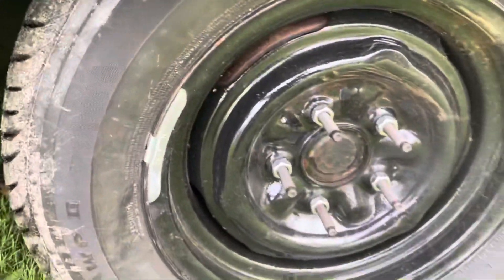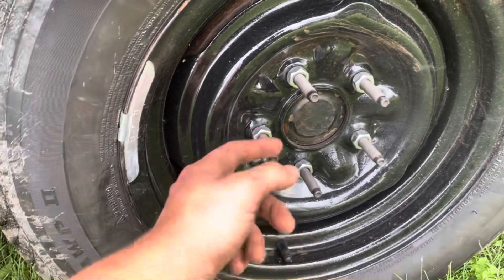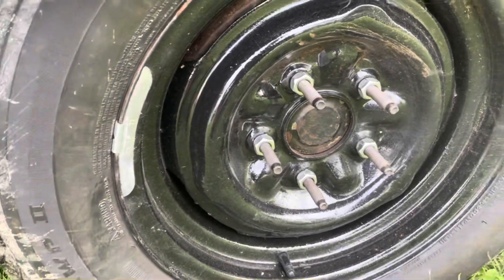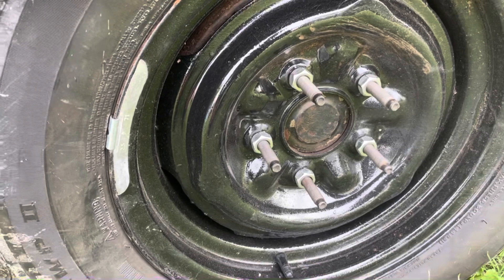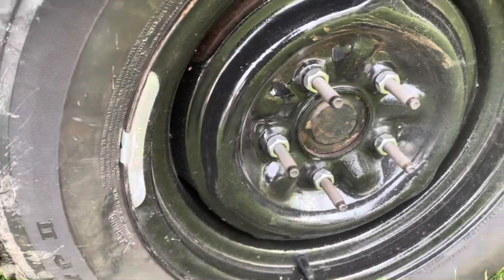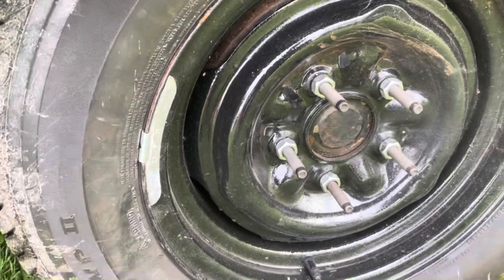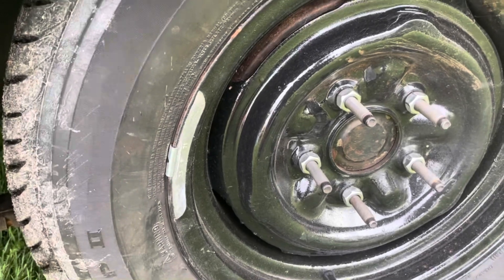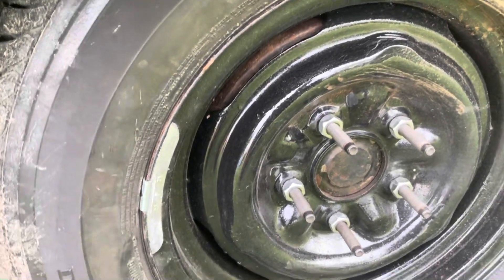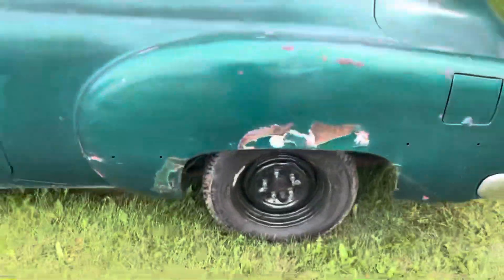What the 560 knurl means — let me walk back here with you. The knurl is the part that goes into the hub, as you probably saw when Dad was pulling them in. That section is a different diameter than the front. The actual stud itself is the same, but the knurl is a 3/4 OD with a 7/16 by 20 thread. That's all those are, and it's got steel wheels on there for now.